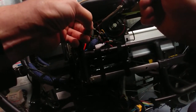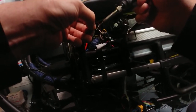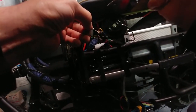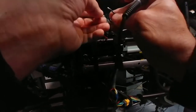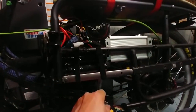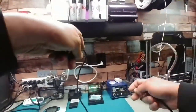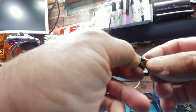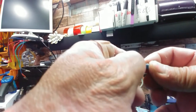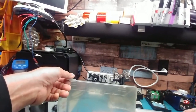We'll put the white wire in the center and the black on the side. Oh — I just lost it, didn't hear it hit the floor. Forget this — this switch is way too sensitive to heat. It doesn't even flip right now, but as soon as I heated the middle pin up to put the wire on it started to melt. It can't take much heat, so let's find another toggle switch.